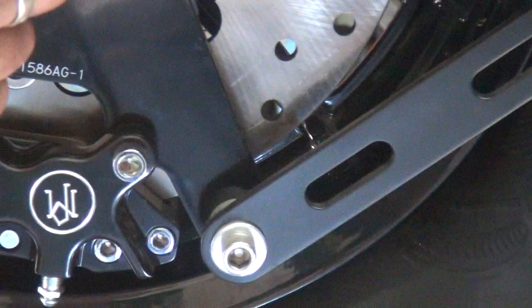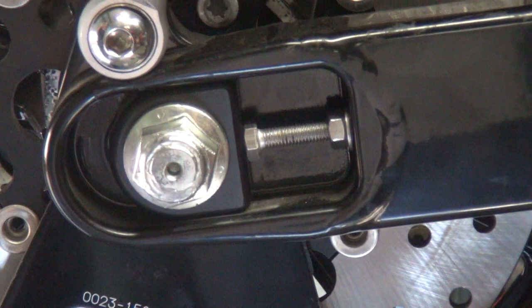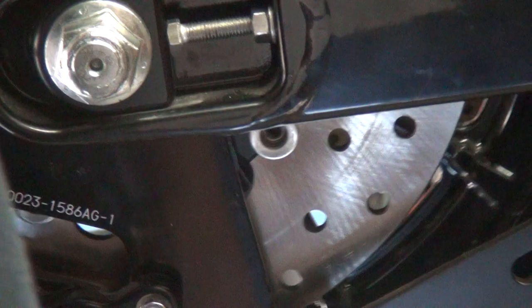Okay. You know why I have the axle in from this side, right? I always do it the other way, but I don't like this way. If you put the axle in from this side and you put the header on, then you always have to take the header off to remove the axle. I had it the other way, but the end of that axle was a little bit too long. Harley likes them backwards because they have some theory about rotation with a loose axle pulling off the bike. Right, but these have a clip on them anyway. My theory is to get something that comes out when you want to work on the bike, and tighten the nut down.